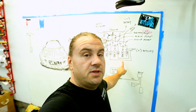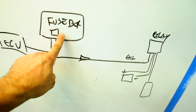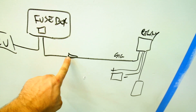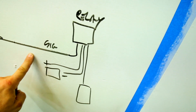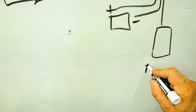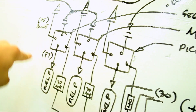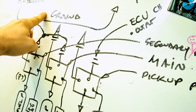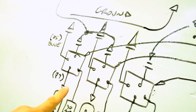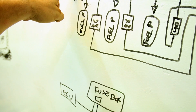Let's go ahead and look at our diagram here. I mapped up everything we need to do and also the current system that is in the car right now. The ECU sends a signal to the relay in our fuse box, and the relay sends a signal out to our other relay that we're actually mounting right now. But currently we're just sending the signal out, and this was actually feeding the pump — this being our fuel pump. This is our battery; the blue in our case is pin 85, and all relays are the same. Blue is ground. The ECU trigger feeds the relay.